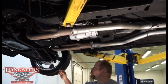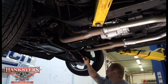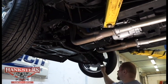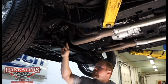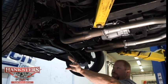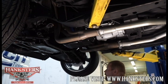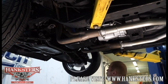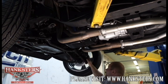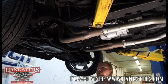We can also look at the steering components, since those are mounted to the backside of the crossmember. All the tie rods look to be in good condition on both sides. The rubber dust/grease boots are all intact, and the Zerk grease fittings are all intact too — those boots keep dirt out and grease in to keep the ball joints properly maintained. We've also got front disc brakes on this car, and those are power disc brakes, so this car is going to stop real well with discs up front and drums in the rear.